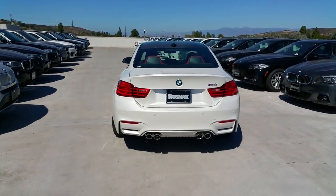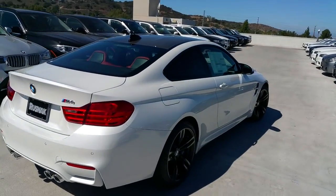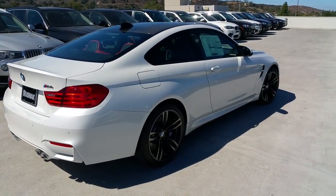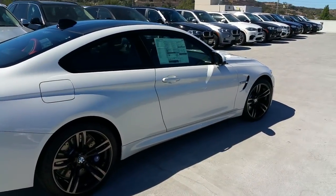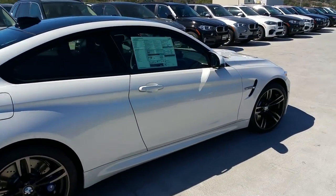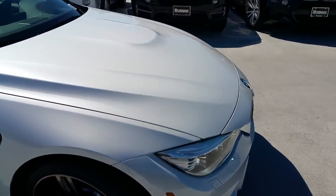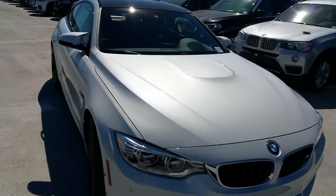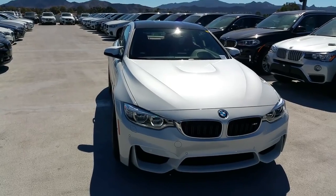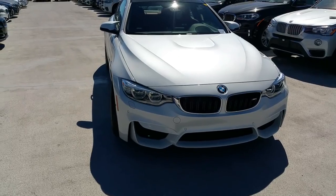Also a little bit about the S55 engine. It is a twin turbo, guys, with a mono-scroll turbo on each side. We do have some engines in the lineup that have a twin-scroll single turbo, but not the M3 and M4. One thing that's nice: we've got 2% more power coming out of the turbo 6 than the previous V8, at 425. Also, we've got 38% more torque, at 406, than the previous V8.